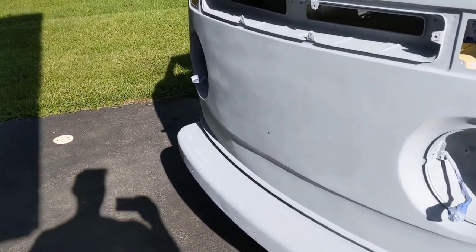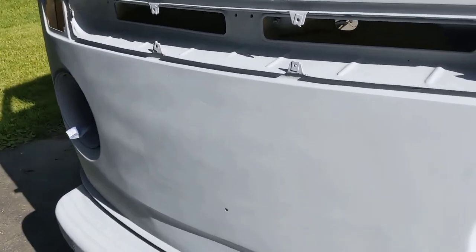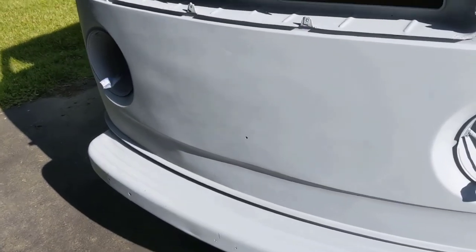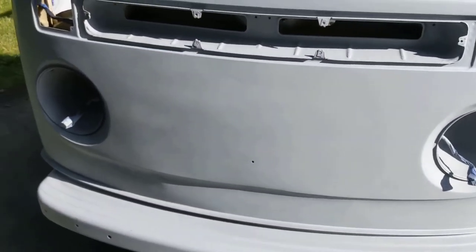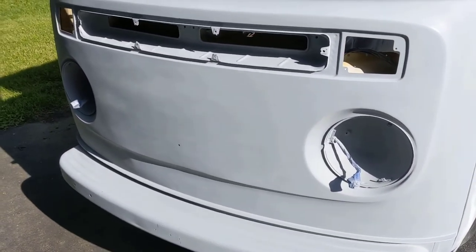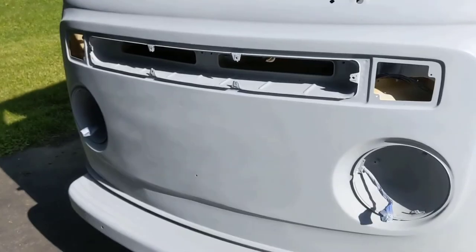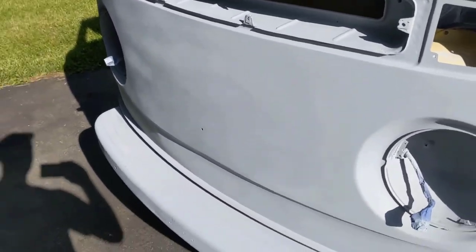Another day of working on the front, and I think I'm just done with it. It's not great, but it's definitely good now — I'm happy with it. This is in pretty decent shape. It's feathered in pretty well all around the edges. It's fairly smooth now — you can run your hand over it and there's not much rippling. It's not perfect, but man, this is about as good as I can get and I'm happy with this. This is three or four rounds of sanding, prepping, glazing, sanding, prepping — repeat and rinse about two or three times.